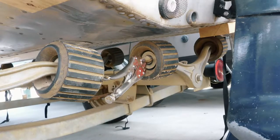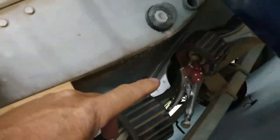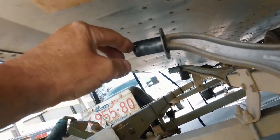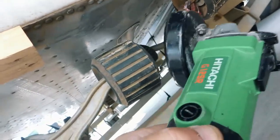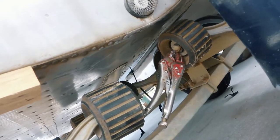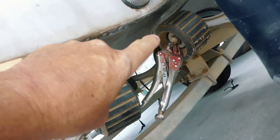This is probably going to look crazy, but these axles are just aluminum. I'm finding when I'm prying out those steel clips, on one of them I had a little piece of that aluminum break out. So I can't afford to break the end of this to where the clip isn't going to be able to hold in there anymore. So I'm going to cut all these clips with the angle grinder. It's going to take me a lot longer, but I'll cut every clip with the zip disc, and that way I'm not going to damage the axle.